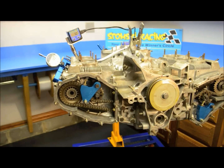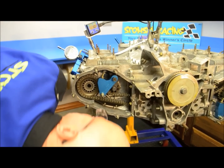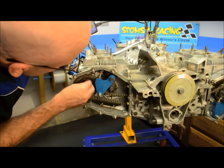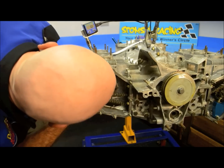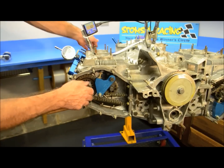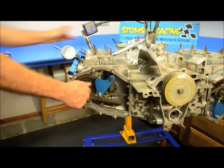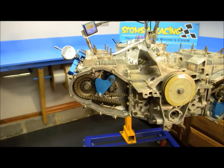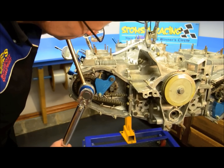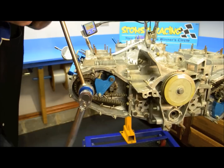Now find the pin and find the best hole to mount it in. I'll put two hash marks there so I know that was the second spot, in case we have to take it off and start again. Now 88 foot-pounds of torque on here — it's 110 for the earlier cases with the nut.